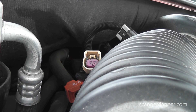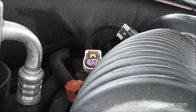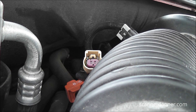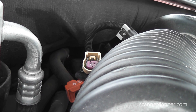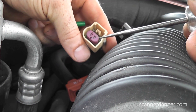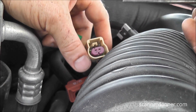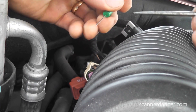I'm going to take my test light to ground with the key on and check my light first. It's a good thing I'm doing that because my test light is not lighting - there's corrosion on this battery giving me a hard time. Just because you're connected to the battery doesn't mean you're actually on it. Also, these pins are really small - we don't want to jam a big test light probe in there, that would be really dumb. That's what the t-pin is for.